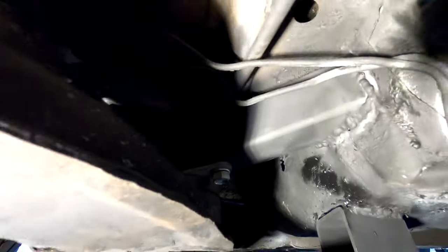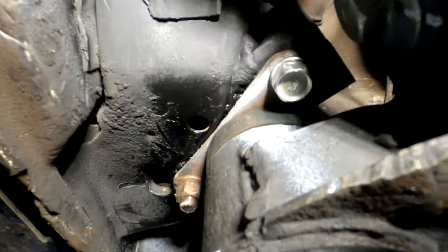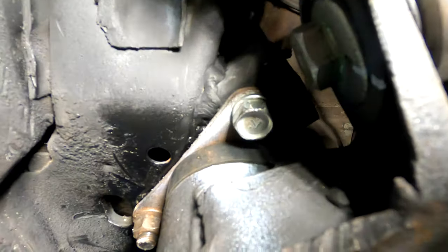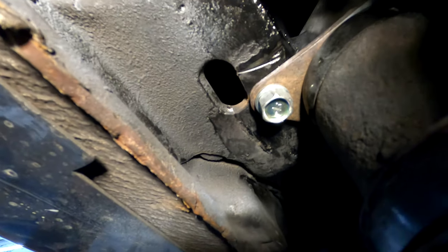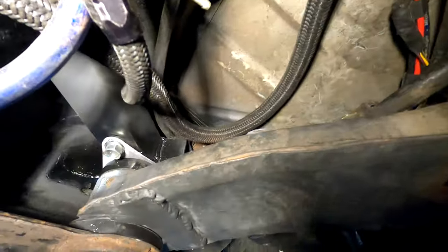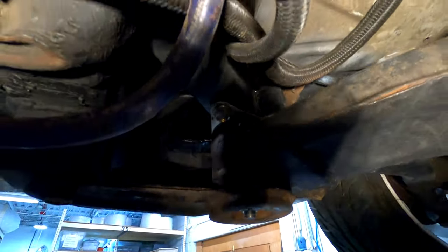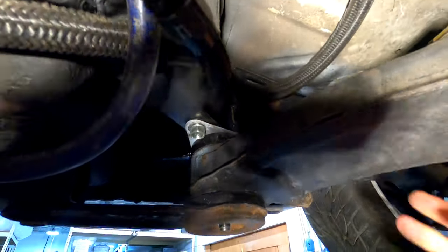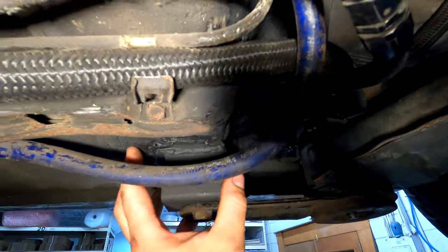I've got the rear stud over there, a bolt here with the welded nut inside the new frame, and we've got our brand new nut, eccentric washer, and other bolt back in there — it's like a little ear on the new frame that I welded in. Same thing on the other side — nut welded inside. I could have tapped out this stud but I stupidly ground it out beforehand. On this other one I actually was able to tap it and just use the threads instead of doing any welding.